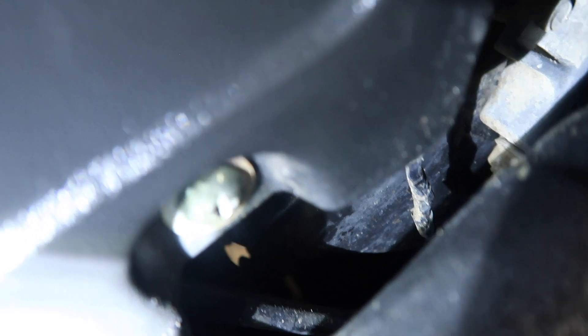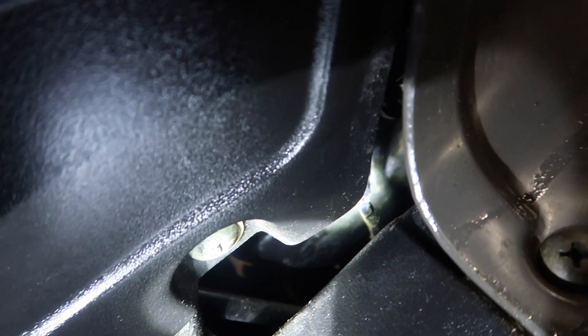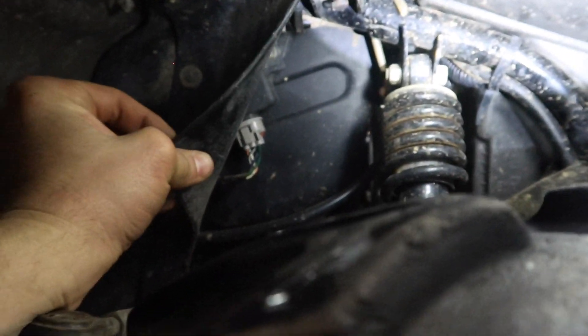It's tricky, but you can reach back in from the other side. Come right in here — you can see the bottom of it and there's our other bolt. You can sneak in there and pull out that bolt. I've done it, and you can replace the CDI just like that. The trickiest thing is just getting that back bolt out; otherwise it's all right behind that piece of plastic which you can easily pull out of the way.